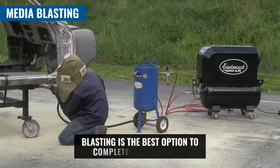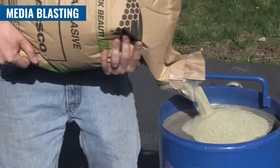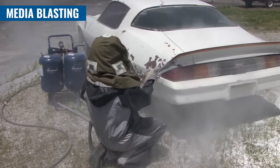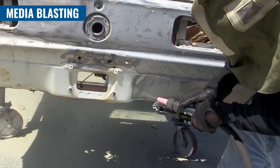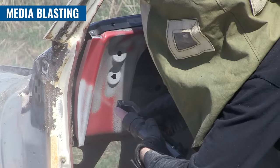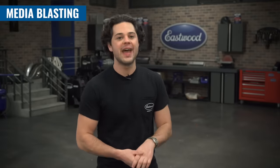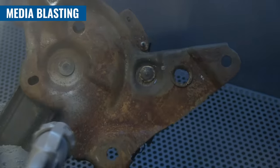Blasting is a process of using compressed air to blow abrasive media across a piece to remove rust. That media can be glass, silicon carbide, aluminum oxide, walnuts — it'll depend on what your project is. Here's Kevin working on his Camaro project — this is the best way to remove rust from deep pits and hard-to-reach areas. You can see the paint and rust just fly right off. Here's Cody working on his Camaro too — paint, rust, hard-to-reach areas — all that debris flying off to reveal clean bare metal underneath. We have a full line of outdoor blasters, great for larger projects like those two Camaros, but also a bunch of different sized blast cabinets for smaller stuff like wheels, valve covers, and brackets.